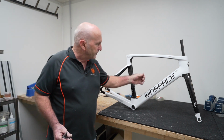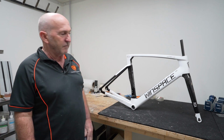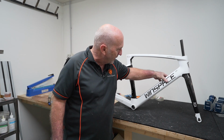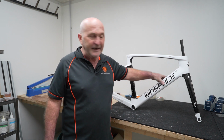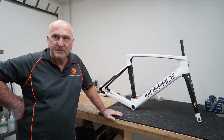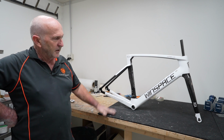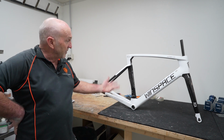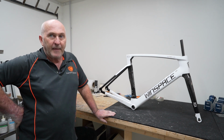Sometimes on really high-end resprays, we'll then sand it flat again and flow coat it to make it perfectly smooth. There's not much of an edge there, but you can feel it, but I haven't seen a bike yet that's got bare carbon decals where there isn't some sort of edge. But we could have made it smoother with a flow coat. And the only other upgrade we could have done from there was ceramic clear it, which is one of my favourites. What does that do?